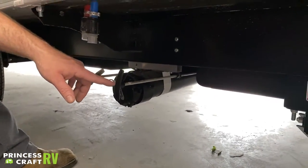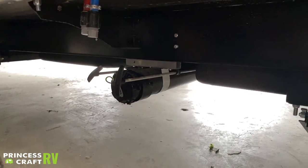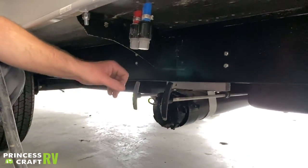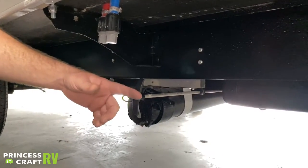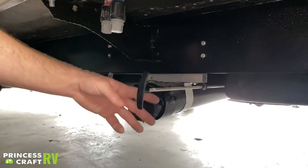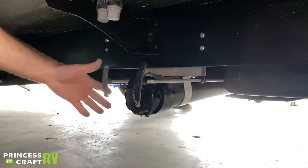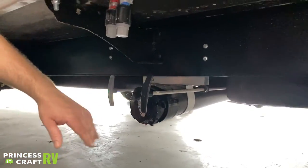While we're down here, this is your dump station — two valves: gray on the left, black on the right. Liquid waste is sink and shower; body waste is toilet alone. Take your bayonet cap off, hook your sewer hose on, dump your black tank first. When done, close that off and open the gray tank to flush your hose out. Once that's done, close all valves and you're good to go.